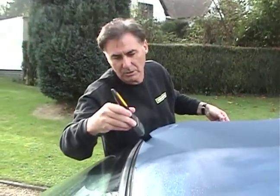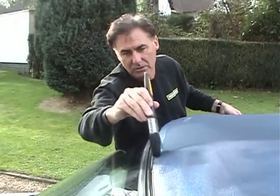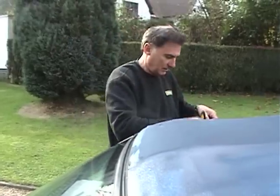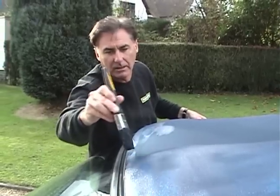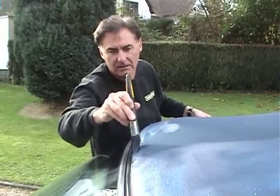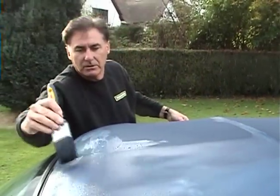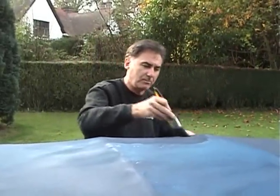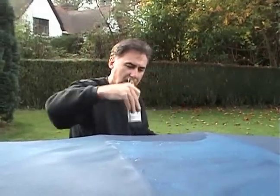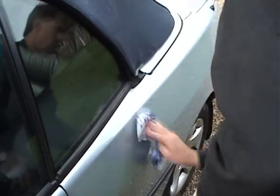It's essential to work quickly. Pick out a small panel and concentrate on that one panel, up to an edge, up to a stitched area. It's also a good idea to start in the middle and work to the side. Do not apply it in direct sunlight because the product has to soak into the fabric. If you get a spill, it's easy to clean up without damage to the paint or to the acrylic windows.